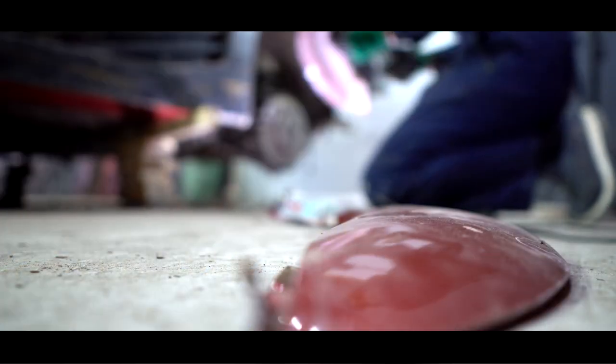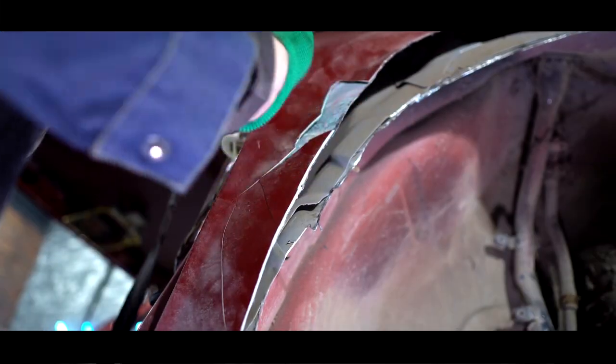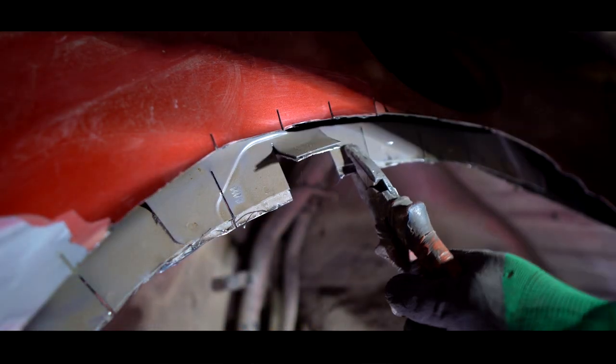I'll make it with the help of notchings, but beforehand I'll remove the entire putty, which will just serve as an obstacle in future. I bent the saw cuts along the arch, which further will be welded and covered with the undercoat. I won't do this yet since I may have to increase the arch many a time and oft.